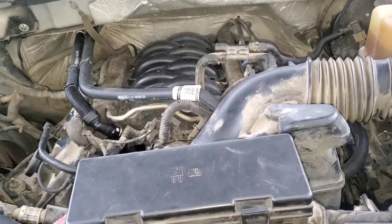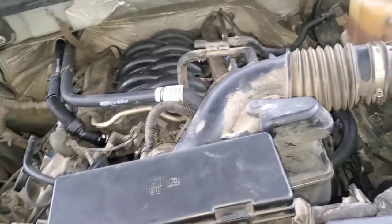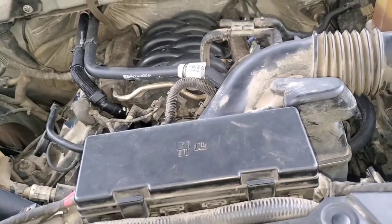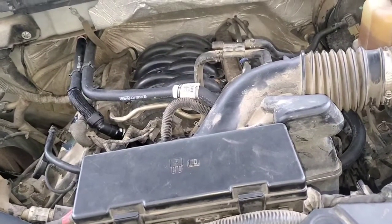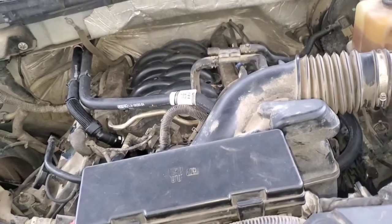When I put it back together and test drove it, once the engine gets warm and you put the bypass relay in and crank it, it sounds great and no longer misfires when it's warm. Those valves actually seal when they get hot. I'll put a picture in here, but the valves are knife-edged real bad — there was no valve margin left on both intake valves. They were no longer at a 45-degree angle; they were dished really bad.